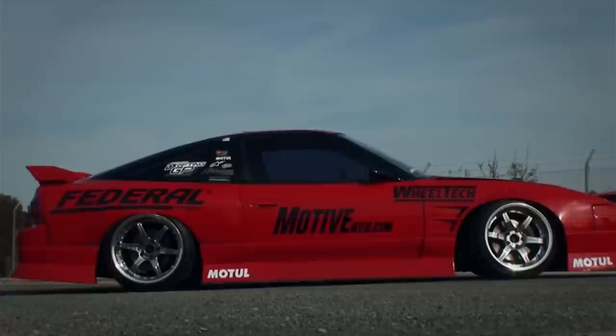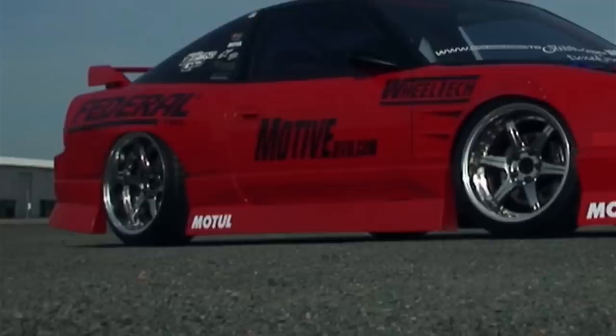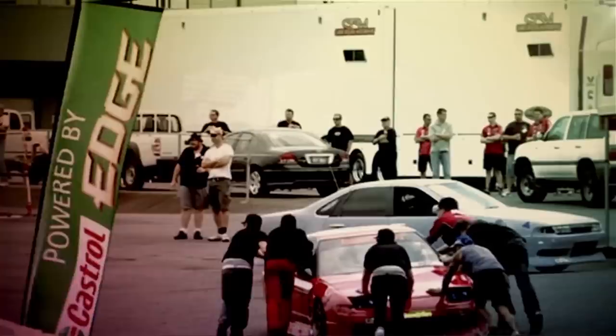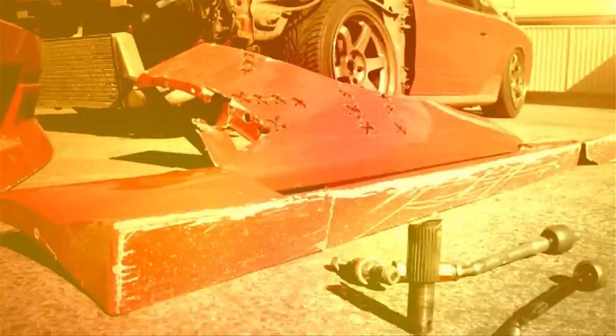Part of Nigel's car looking this good is how low it is — ridiculously low. But unlike a bogan's chop-spring Commodore, this 180SX still handles and drives the way it should, thanks to Nigel's clever suspension modifications. I think drifting is a show — I believe in a car looking good, but I also believe in a car that works properly. I modified the rear knuckles and that worked great, no worries. But the drive shaft boots would just tear because they're on such an angle. The car was a little bit unreliable, so I pulled the rear subframe out and got the angle grinder out and hacked the shit out of it. The subframe is now about 80mm higher up in the body and the diff is hard up against the floor. All the chassis rails are notched for the subframe to sit inside.